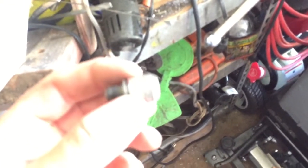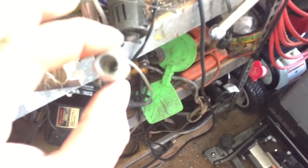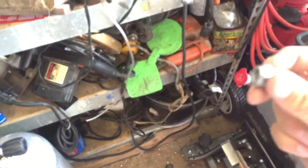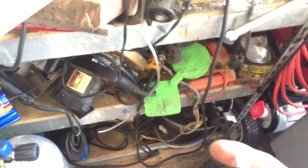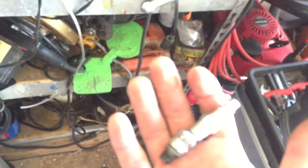Sorry, my phone's a little blurry today. All I've got to do is get the adapter that'll fit the compression tester. Look — there's the hole in it. Now all I've got to do is take the old spark plug piece and here's an air chuck nozzle, and I'm going to braze it together.